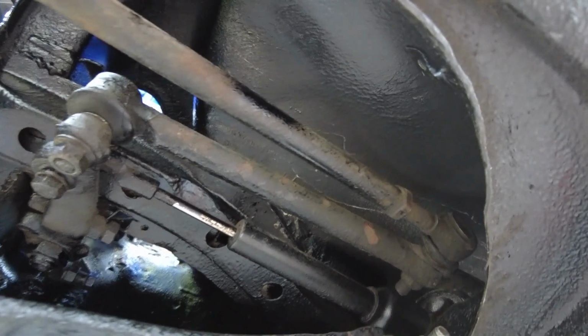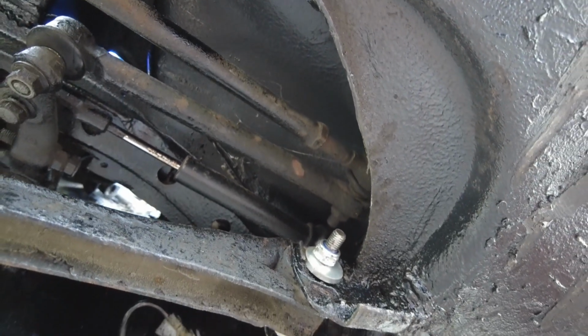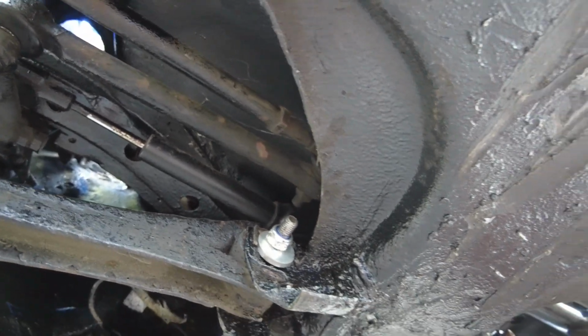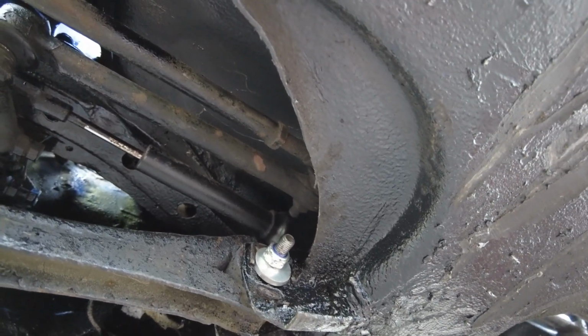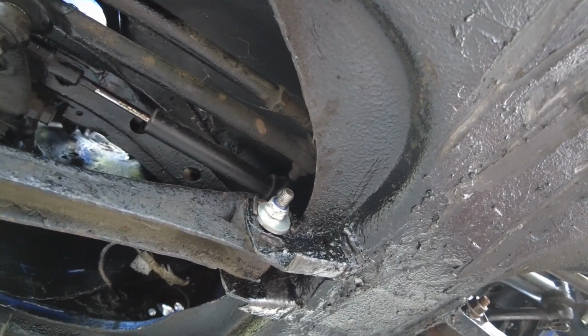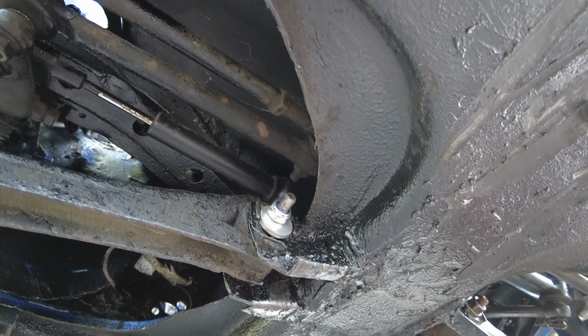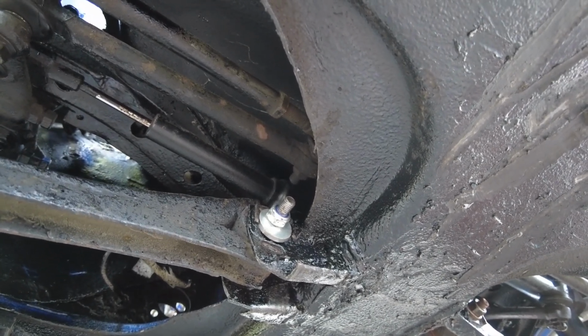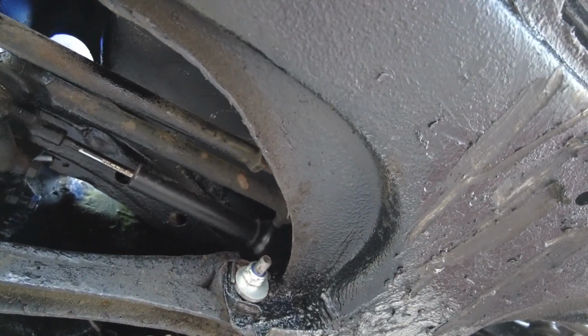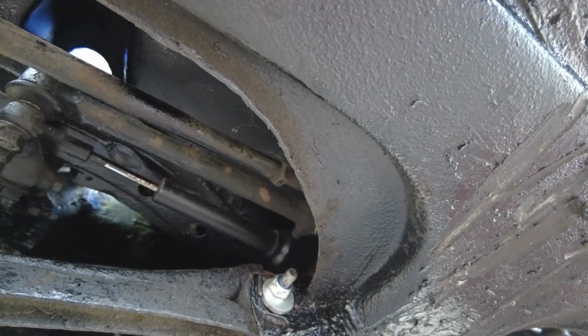And when we go looking underneath the car, you will see that the bolts with the eccentric washers on the lower control arm, there we are, have also been replaced. Now I wanted to replace them because the old ones, it's like a D-shaped bolt, and the washer has got a flat in the hole, and some idiot rounded out that hole, so the washer wasn't locked to the position of the bolt the way it should be. So now it is, and that gives me a little bit more peace of mind. At least that's done. I have new bolts on both sides, so that's another little victory.